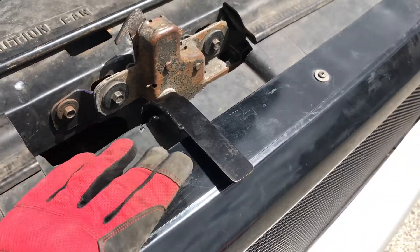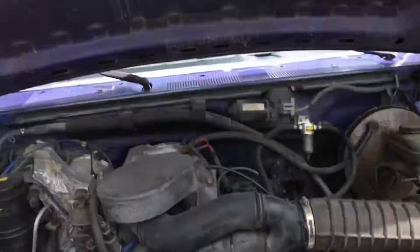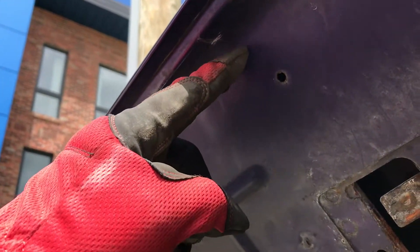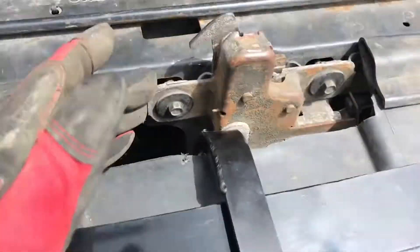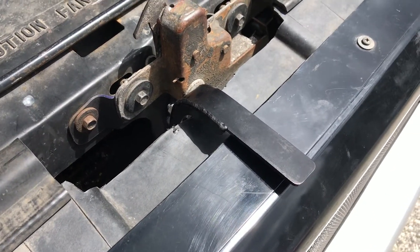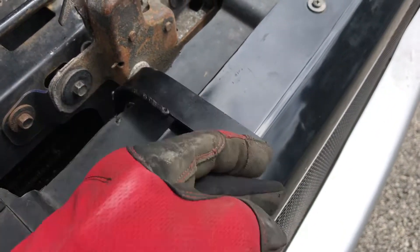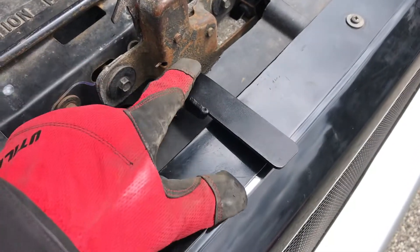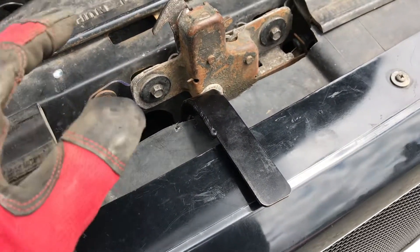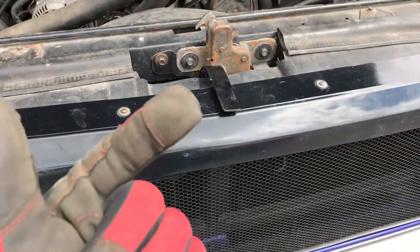The product itself — my third thing — is that this tab is too long by at least a quarter if not a half inch. The reason is you'll actually end up scraping some under-hood paint, as you can see right here. It should stop somewhere where the hood curves down. I get it, it's a universal product and there might be factory variations from truck to truck and Bronco to Bronco, but if you get this, maybe get a head start and just cut off a good half or quarter inch to avoid that. It comes as raw steel — I've painted mine because I didn't want it to rust.